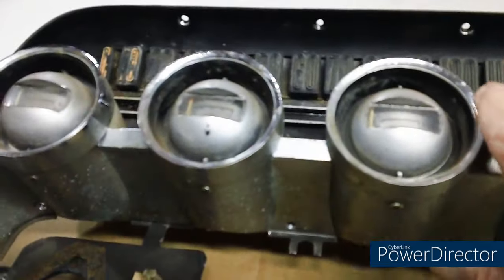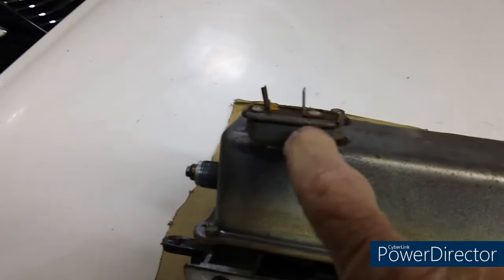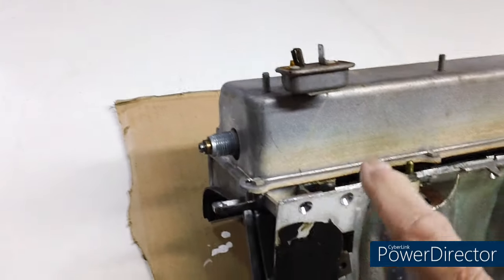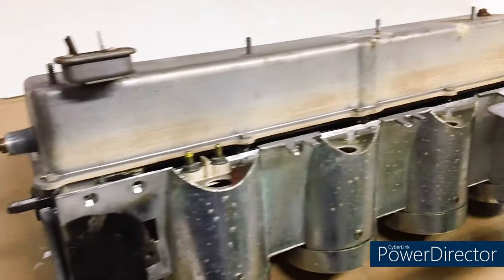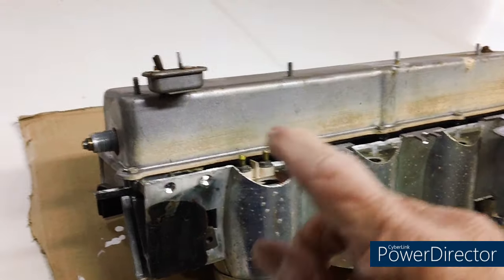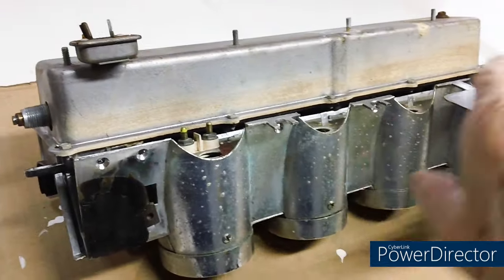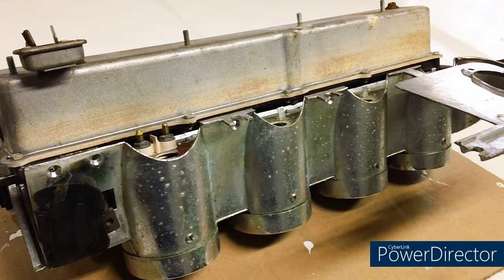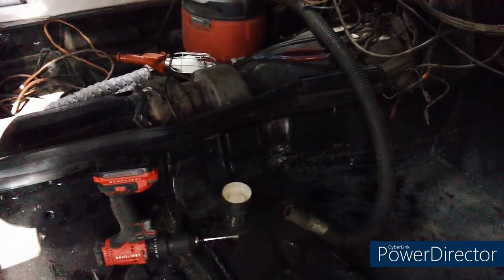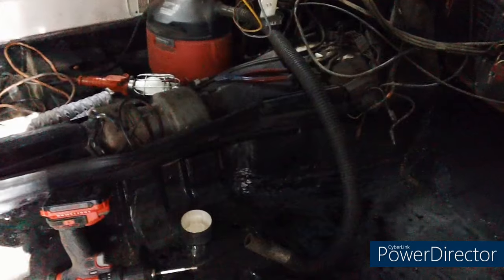I should have realized it's a lot bigger than the CVR. Let's take a look at the actual CVR now. This is the instrument cluster - on the back of it you will see the actual CVR. It almost looks alike, except the one I showed you earlier is about this long. That's what provides the required voltage to the gauges on the instrument cluster - I think it's like six volts. It's a pulsing thing - it's got a set of contacts that close, heat up and open, close, heat up and open, so they don't burn out the gauges. By the way, those CVR - constant voltage relay - they make reproduction ones, but according to Nick Pepe of Vintage Thunderbird Repair, he said they're just not anywhere near as good. Try to keep the old ones and use them as long as you can.